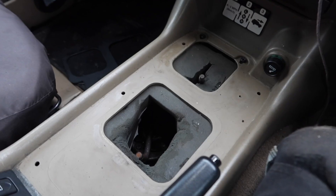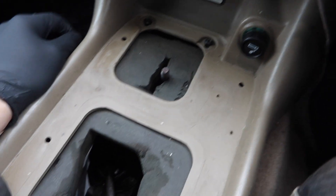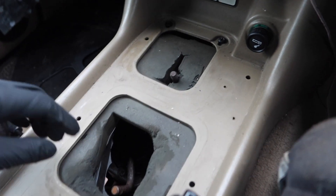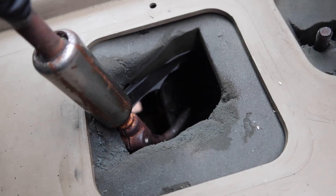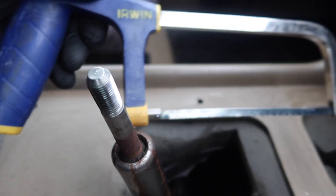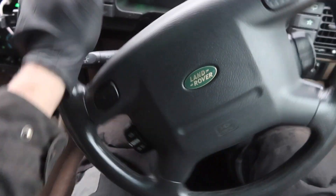Annoyingly I've put it back together and realized I've got no gears. I think this was just slightly over here which is neutral — so that's the transfer box in neutral. I can now put it all the way to high and move the gear selector into reverse because I need to go backwards. There are wheel chocks, and as you can probably see it doesn't quite fit because we're hitting this, so all I'm going to do is cut a little slot in it and it should be fine. Mission successful — drives okay, except for this squeak.